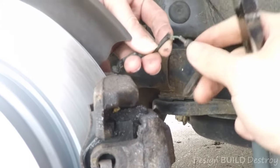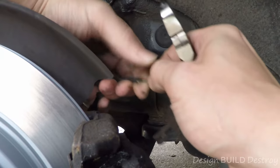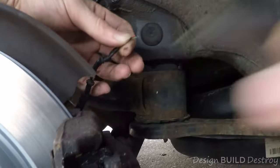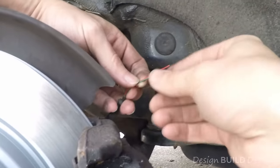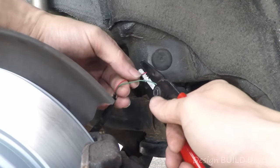There you go, that's why she tripped — you can see the wires separated out of the body, which is what we're going to do anyway. So cut off the other end, peel this back, and we're just going to tie these two together, heat shrink them, and zip tie them in place.